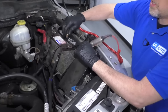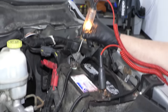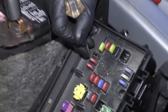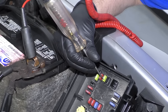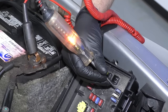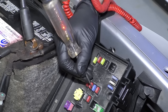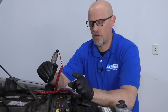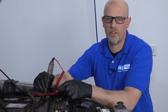It's always a good idea to check your fuses. Take a test light, put it on the negative terminal, double-check your test light works, and open the fuse box. You can check each fuse — there's a little opening on the fuse where you can push the test light in. Make sure the light lights up on both sides. You could just check the fuse for the starter, but it's always a good idea to check them all. If you find a blown fuse and replace it, that doesn't mean it was the only problem — fuses don't just blow on their own. There's normally another issue, whether the starter is drawing too much amperage or there's a wire that's shorted out.